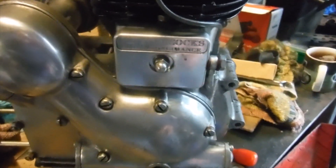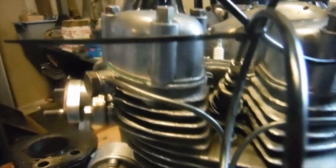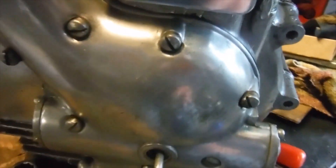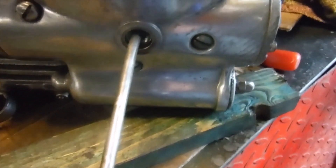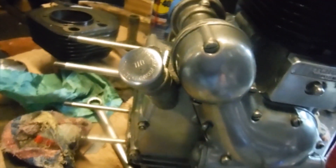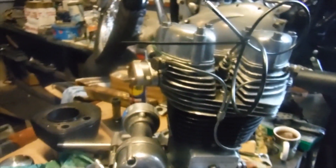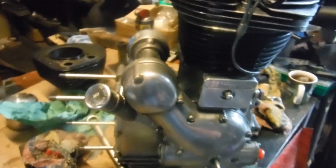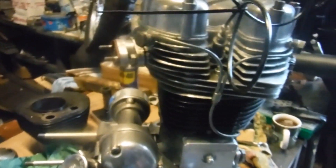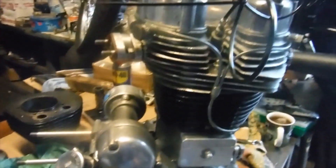Because the scavenge oil on these engines is picked up directly from the crankcase and pumped straight back up to the rockers, any debris in there also goes up there. So I've cleared all that out — rockers, pipes, banjo connections, everything spotless. I've got a new oil filter in the timing cover, filled with clean oil. Subject to the owner fitting the engine and filling it with oil, it should all be ready to go again. Let's hope it might be third time lucky for this poor engine — it's all in tip-top shape now.